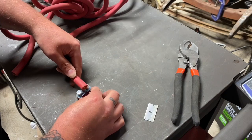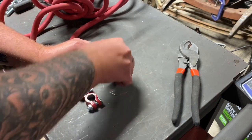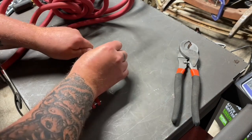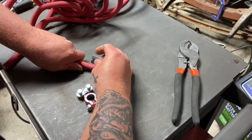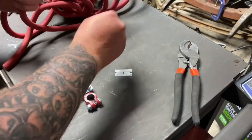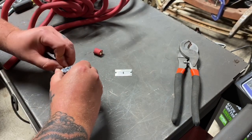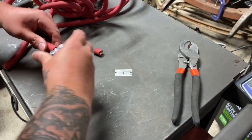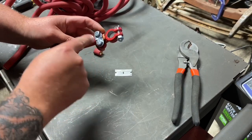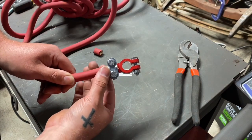Let's strip this to get it onto the battery terminal. I'm just going to eyeball the length — we don't want a whole bunch sticking out the back, and we don't want the power to jump anywhere. I'm just going to cut this with a razor blade. I'll probably put some red shrink wrap on the end of it — I always like to have as much protection on the positive wire as possible. It slides in there and butts right up — that's exactly where we want it. If you cut it too long, get some shrink wrap and cover it up.